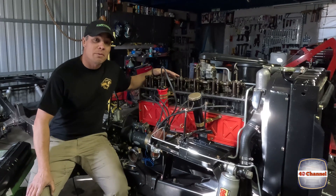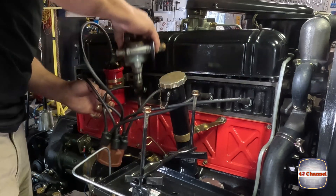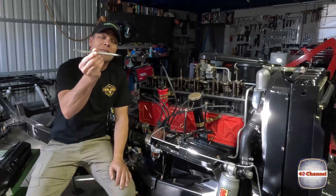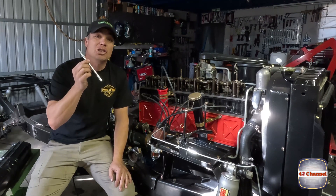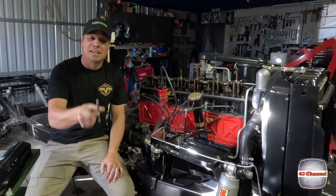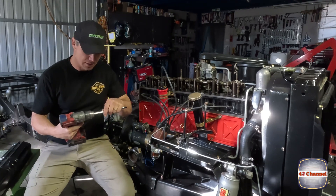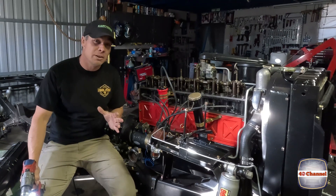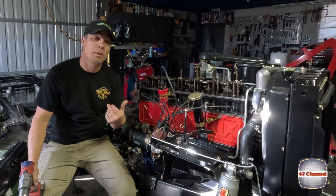The quickest way we can find out whether the oil pump is doing what it needs to do - we rip out the distributor. We're taking the top off. I bought the cheapest flat-head big screwdriver I could find - this one was cheap. I just cut the handle off, and this one actually has a hex on it too which makes it even better for grabbing into the drill. Chuck it in the drill and we're going to put this down into where our distributor was.